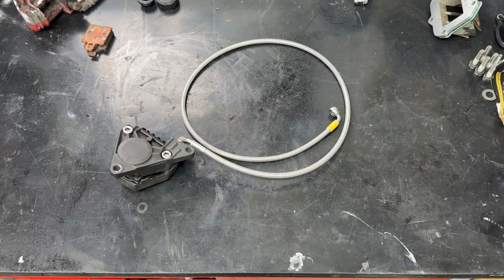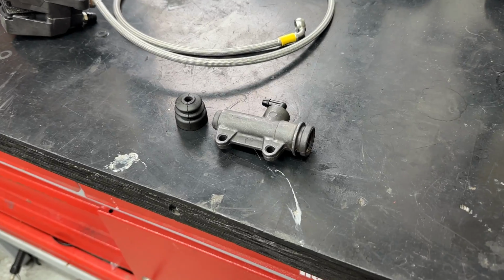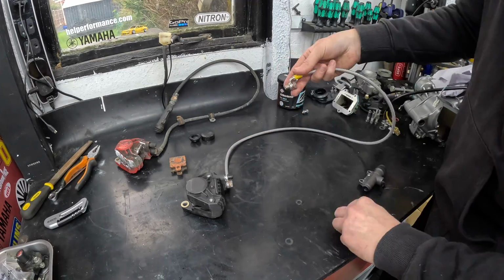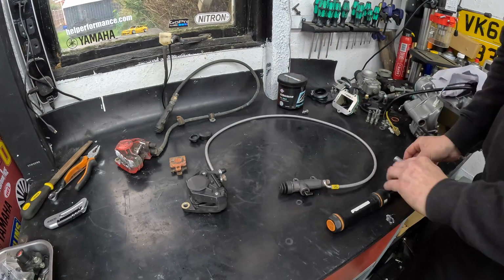And as you'll probably note from the master cylinder on the old bike, it has a pressure switch in it, which is slightly different to what I'll be running, as I'll be running a daytime MOT. I'm not going to need rear brake lights because there won't be any on the bike, so I didn't need to refit the pressure switch that comes as standard with the RS125.